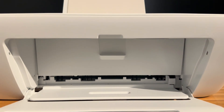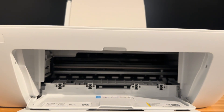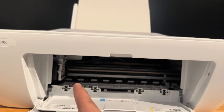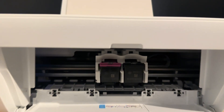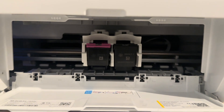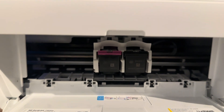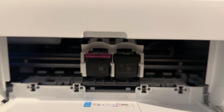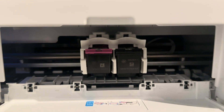For our normal fix, we'll first go into the actual ink cartridge tray itself. It's going to very nicely present us with the ink. Remember, you're going to want to put your tri-color ink on the left and your black ink on the right. If your tri-color and black inks are mismatched or the wrong way around, that's what's causing your E0 error.